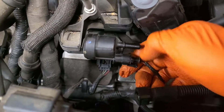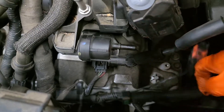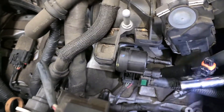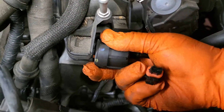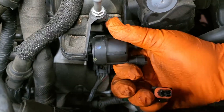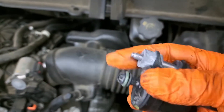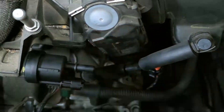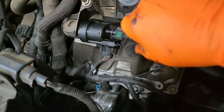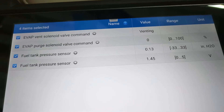We've already got our vapor line off. Next we'll disconnect the electrical connector, and then there's a 10 millimeter bolt underneath here and it should slide out — it's got an o-ring on it into the intake. We got our new one from GM. I'm going to put a little bit of grease on the end to help it seat. Got our engine cover back on and our new valve installed. We're going to start it.